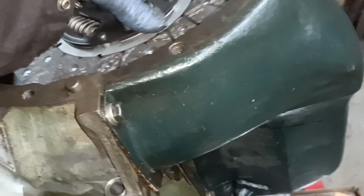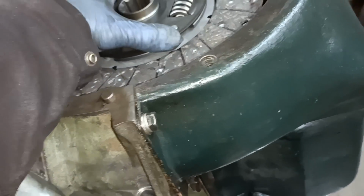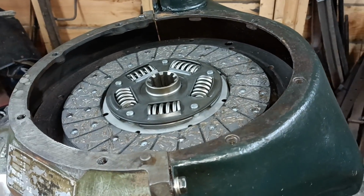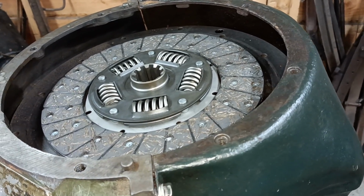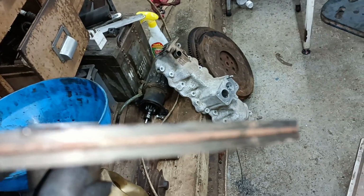But that sits down now without catching. Okay, right. Another little disaster averted, hopefully. Not recommended, you know, make sure you get the right clutch plate. What I noticed, if you look at this 11-inch clutch, is that the springs and everything don't stick back at all.